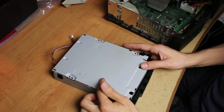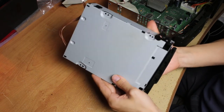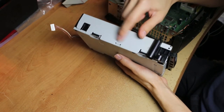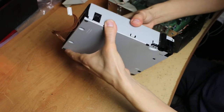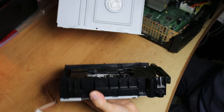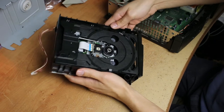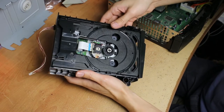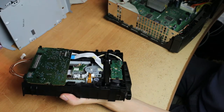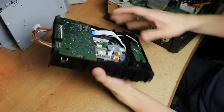We need to take off the metal shielding for this drive. There are basically two different pieces — you're gonna take it apart, and there's gonna be some type of metal latching system here. You can see this is the top part — set it to the side. Then take off the other side as well, and you can see the insides of the Xbox original disc drive.